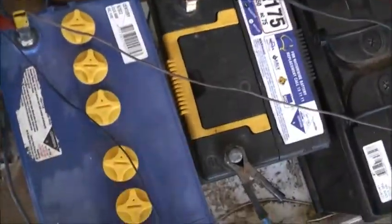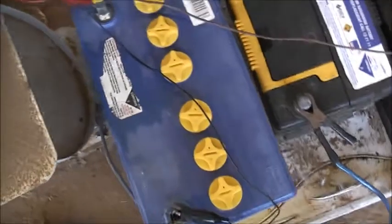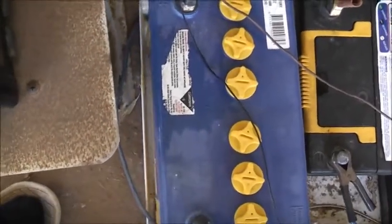If you look inside the cells and look at how physically intact the plates are, you may get a better chance of reviving the batch. But this one is probably the most buggered out of the lot because the plates look like they're falling apart. So there's no way that's ever going to crank anything over again.